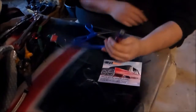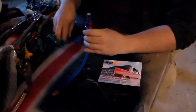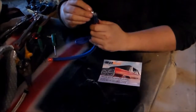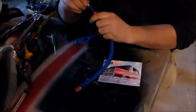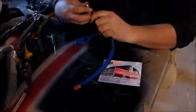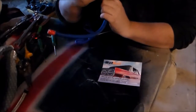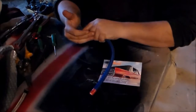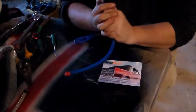After you get it all slid back and your braided braid frayed open enough, slide your ferrule over the hose. Just take your time — that hose can get a little wonky on you so watch it. Once you get it in there just give it a little push until it slides on. There we go, I'm all the way up now.